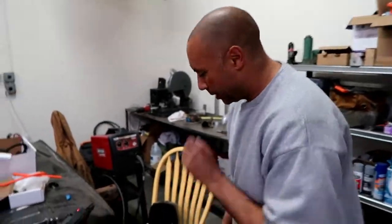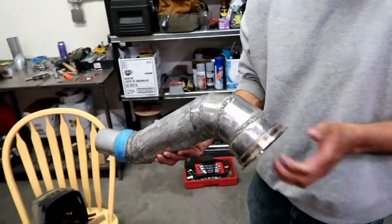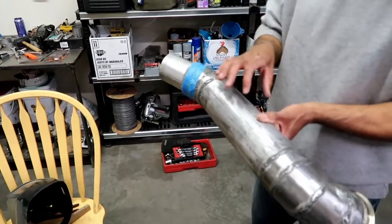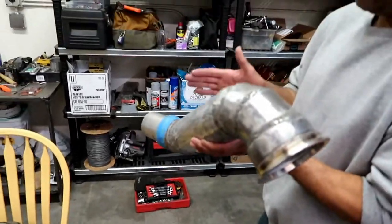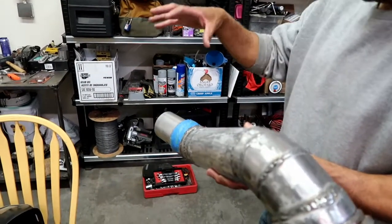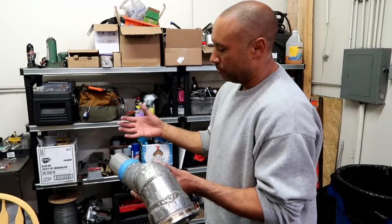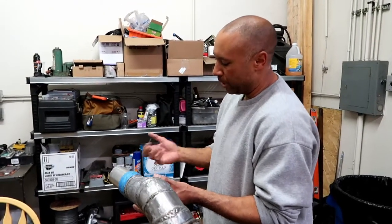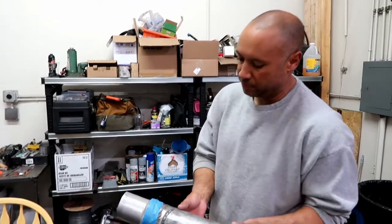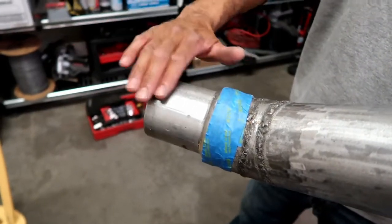Continuing with the exhaust coming out of the back of the turbo — this is where we're at so far. This goes to the back of the turbo, and this goes down by the headers. Little change of plans: this is three and a half inch right here, and we were trying to get it to go under the headers and down the frame rail. But with the AC unit and the headers, it was leaving just a quarter inch of clearance on the top and bottom. As soon as the motor moved or twisted it was going to hit this pipe and rattle. So we decided to neck it down to three inch. This will give us a lot more clearance around the headers and the frame.